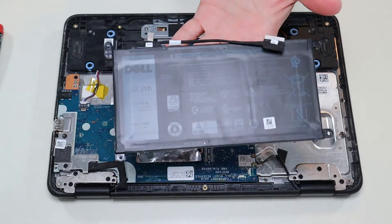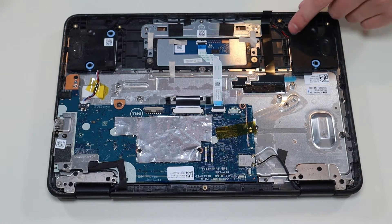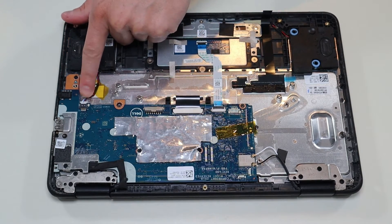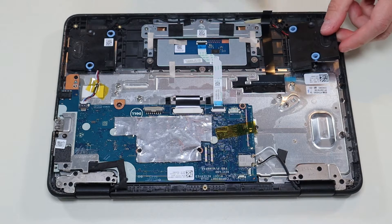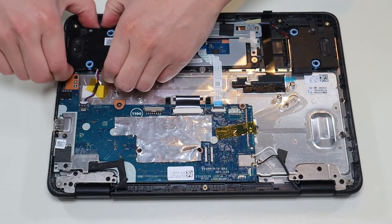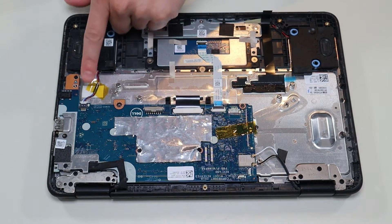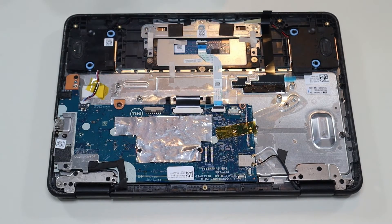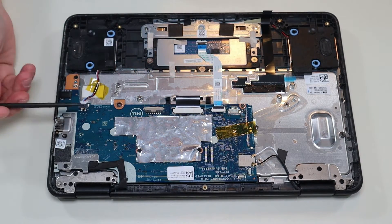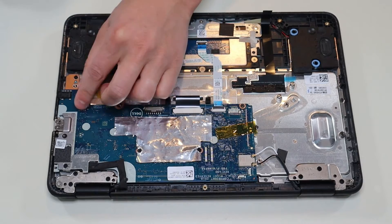After you get that battery up, that's what you're looking at for a battery. Your speakers are right here — it doesn't look like any screws are holding them down. The wires come down here and plug into the motherboard there. To get your speaker up, you just pull it right off — no screws are holding it down. Same thing with the other one; it just comes right up. To unplug the speaker, there's a white port with two grips on either side — use your fingernails or a pry tool and slide it down. Don't pull on the wires or you could damage it.